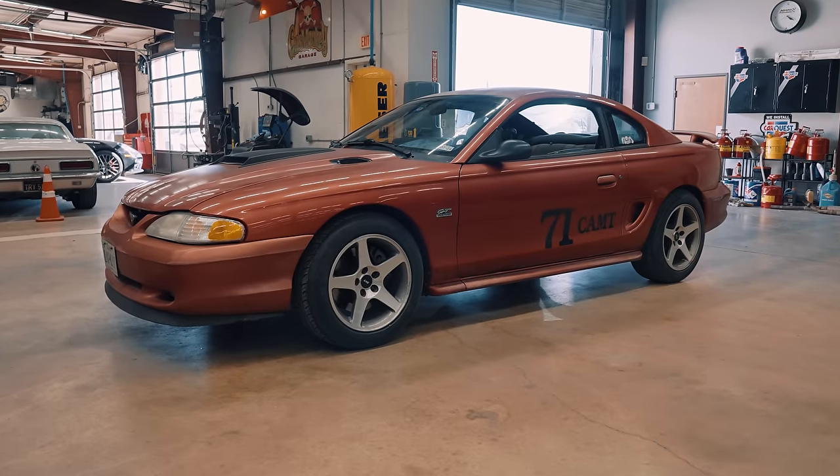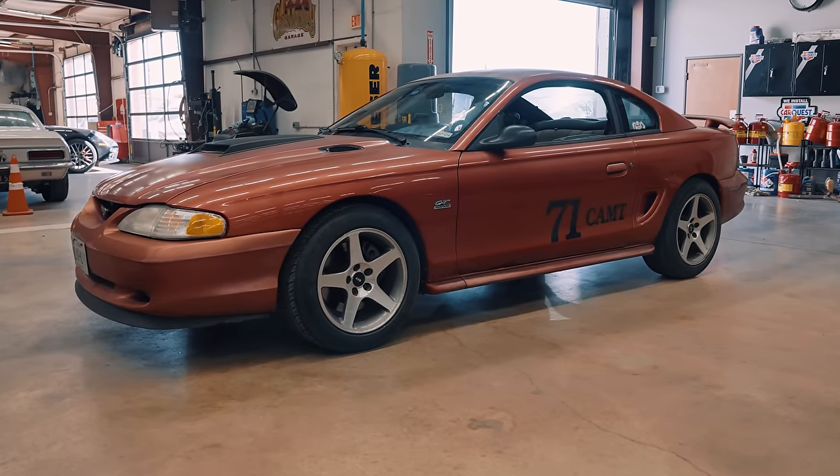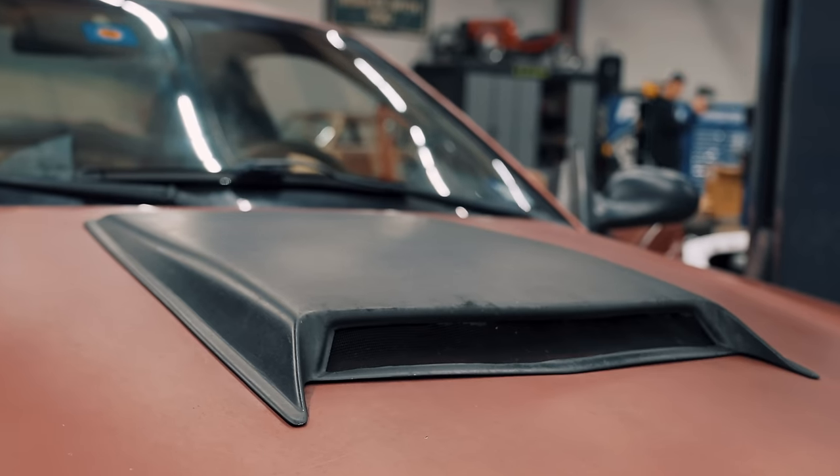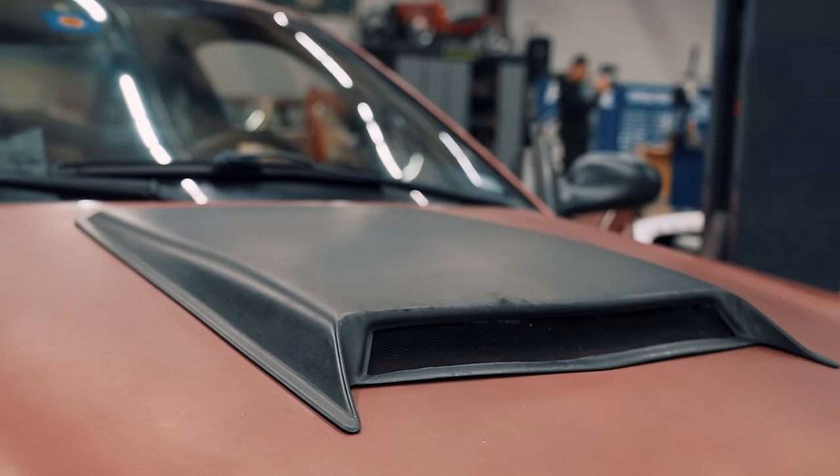Alright guys, we're doing something really cool — starting to dive into some personal projects. We're starting with the old Mustang I built for autocross back in 2020. It's actually won two autocross races and it's been a pretty neat little car, a lot of fun. But it's carbureted, and in the cold, a carburetor car is a little different — not as reliable. So today we're throwing on a Holley Sniper and doing a fresh oil change with some Castrol Edge synthetic oil. This motor has got about 10,000 miles on it and has never had synthetic oil, so I'm really excited about that and of course the fuel injection.